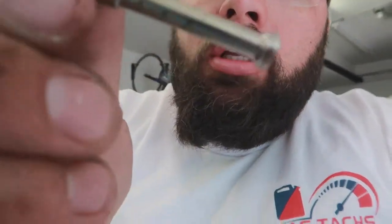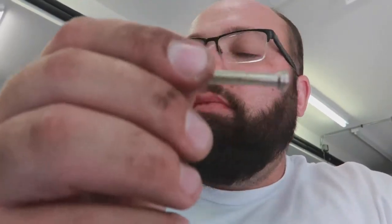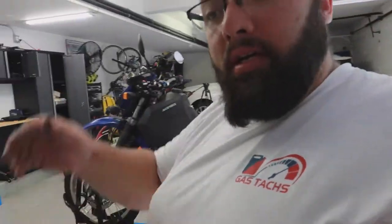One thing I am worried about is this looks like it had a jetting kit on there, and I just ordered a basic carb rebuild kit. This, whatever this thing is, looks a lot different. This was the one I took out of it. Looks a lot different to the one that is in it now. Maybe more holes, bigger holes. So if I can't fondle, finagle, dongle this carb to work when I'm throttling, I will take it apart again and replace that thing. So that's what I'm gonna do now, is see if I can tune it.